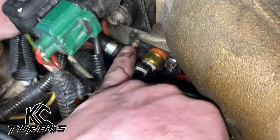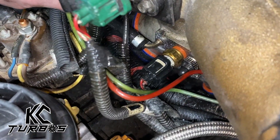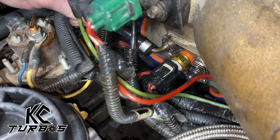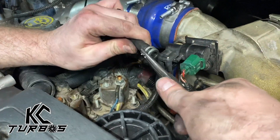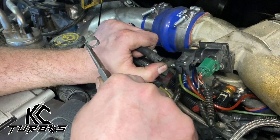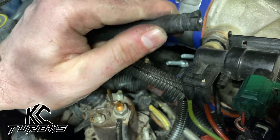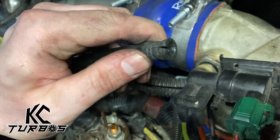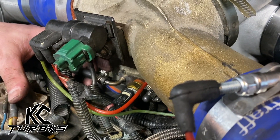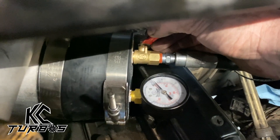We fixed the red hose. When we put the soap here, you can see it spraying off — spraying out of there. And as I wiggle this, it changes the sound. These factory pinch-style connectors are just very prone to leak; they're just not that stout. And as you can see, there's a tear on there. So what we're going to do is cut that back and put it back on with a hose clamp — something that's going to hold it much more snug.